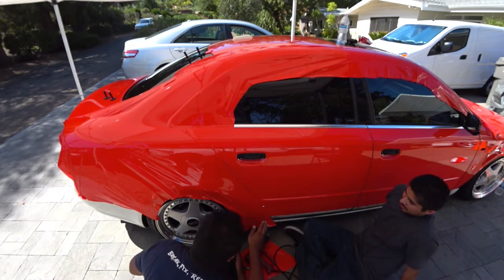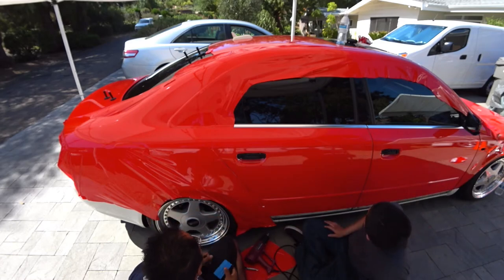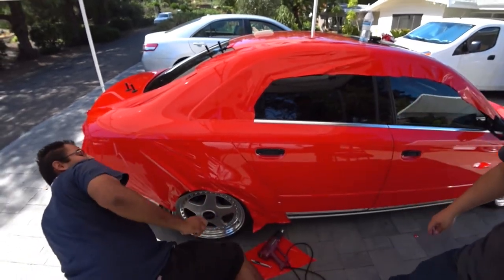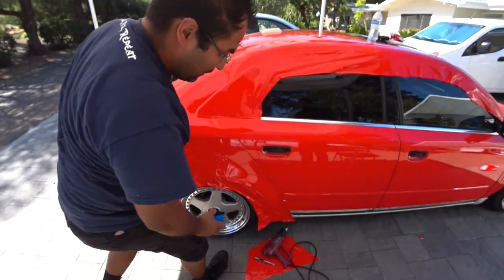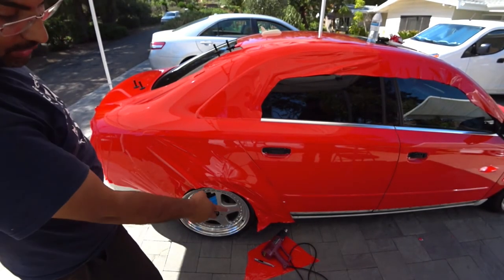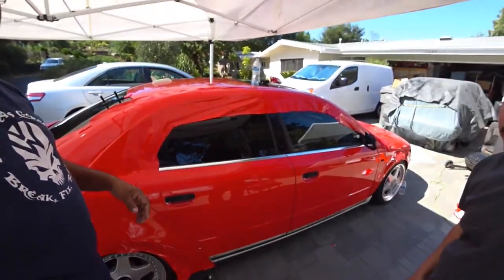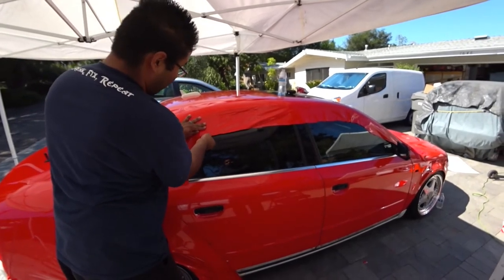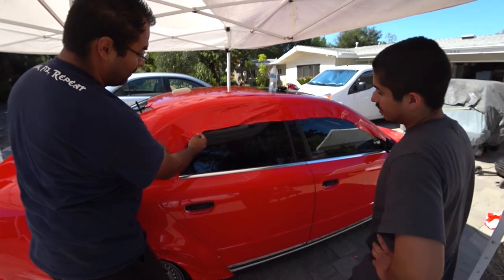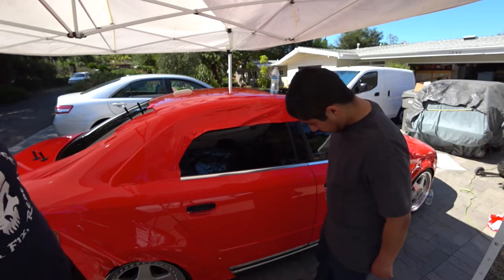So much stretching. So we're gonna have to cut that, but at least we salvaged it. So hopefully you guys saw that, because that is how you fix something. It looks like it didn't change color, because usually when you overstretch it, and I can show you guys an example here, it'll turn a reddish white, and that's when you know you overstretched the material. We kind of try to prevent that as best we could.